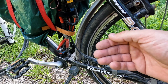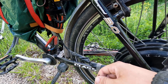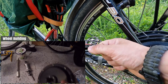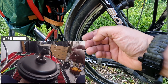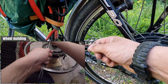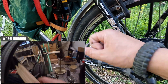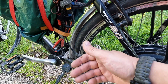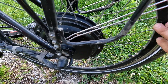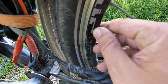I went to a reputable bike shop to ask them to help me put together a new rim for my motor, but they couldn't do the job. So I had to watch videos on YouTube and build my own. Down in the basement I found an Extreme Airline 3 rim which I dismantled. Since the motor spokes have a larger diameter, I cut the spoke holes in the rim larger using a chainsaw file — you can also drill them but I found that too risky. I used the original spokes which were longer, so the ends of the spokes are inside the rim by about 5 millimeters — over-torqued, but it works. Here is the motor I built with that rim, with almost 30,000 kilometers on it, but cracks have appeared on some sides and the rim would need to be replaced again.